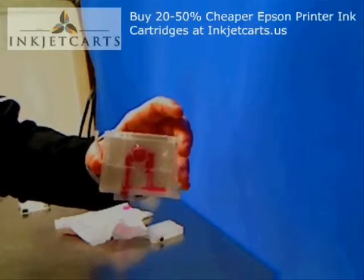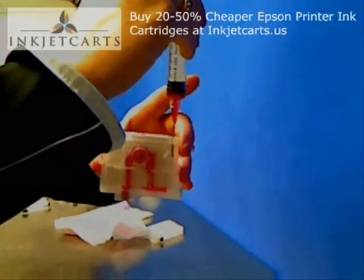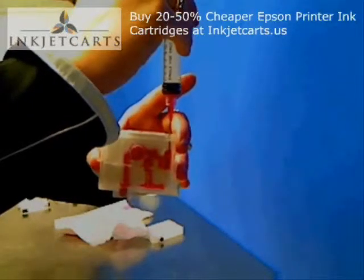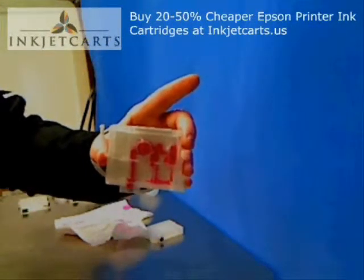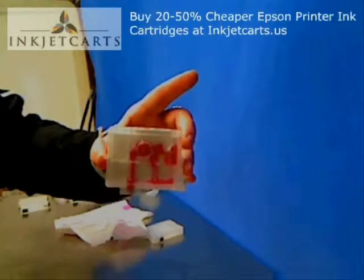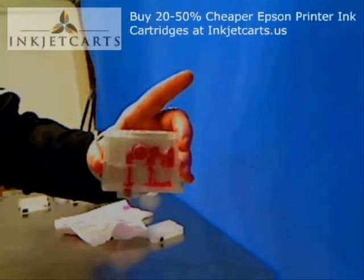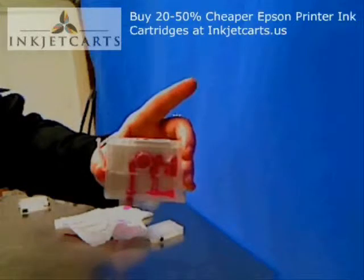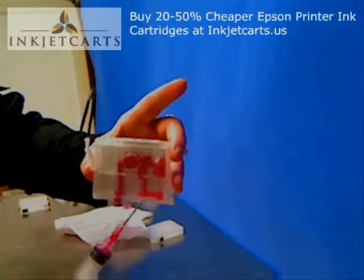Would you use the same syringe and deliver ink to the air port? Here we're going to slowly deliver some ink to the air port. You can see some tiny little reservoirs, some baffling, and a pressure disc. You can see that air never truly made it to the main reservoir — there's just a dribble. This allows the cartridge to burp and relieve negative pressure as you print inks from this reservoir. A little silicone disc is going to burp and allow only enough air into the cartridge to relieve negative pressure, so you can continue to pick up ink supply from the bottom of the reservoir and move it through the internal pathway.